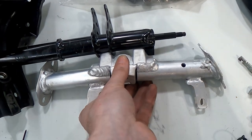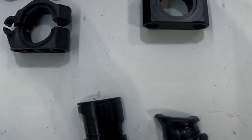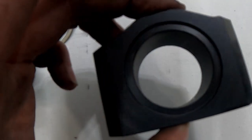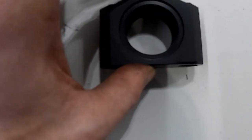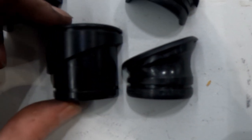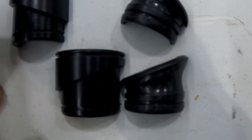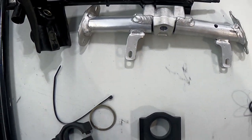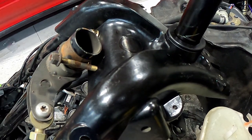These are the two new pieces I'll be getting ready to install. I also have the SSI aftermarket steering bushings. Here's a look at the stock bushing - you can see how it tapers in on both sides. It is a two-piece bushing. Then you have the replacement which is a one-piece bushing that slips over - it's much thicker, has more coverage on the post. Here is the upper bushing - the stock bushing is very thin, this is actually a brand new OEM one that hasn't been used. The new one has way more surface area touching the post and should eliminate some of the steering play. A very good upgrade for any 2016 plus Arctic Cats.